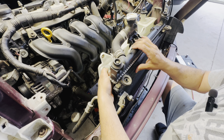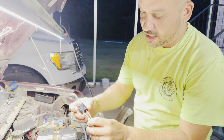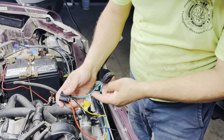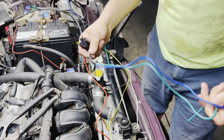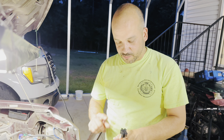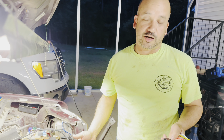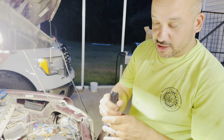I'll go ahead and connect the connections before I leave the spot. This is the relay I'm hooking up. Not every relay you buy is going to be identical colors, but they go fairly close. This wire goes to your battery — it provides power to your fan. This wire goes to the fan itself, and so does this one, so it can run two fans. But I really suggest you run two separate relays for two separate fans, because if a fuse blows — maybe one fan is starting to bind up — then both of your fans go down and you could end up with a blown head gasket.